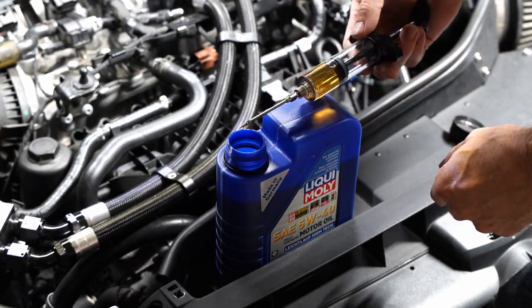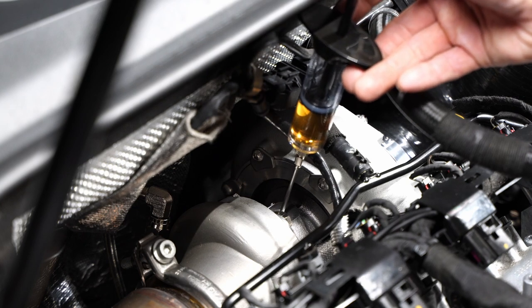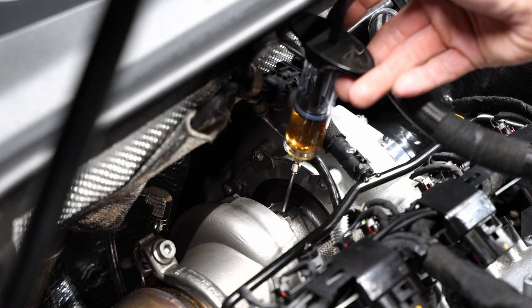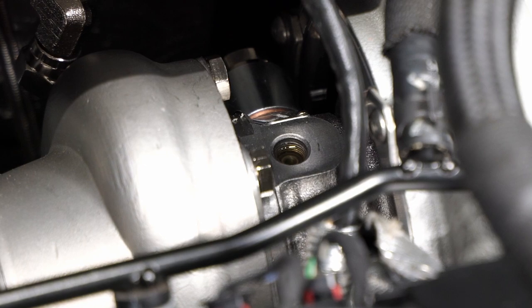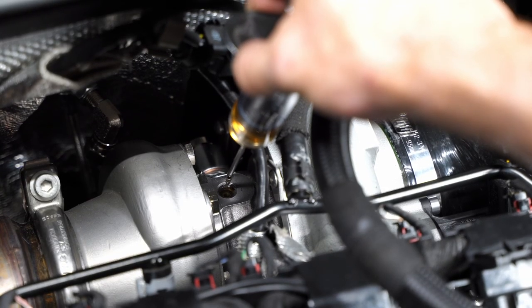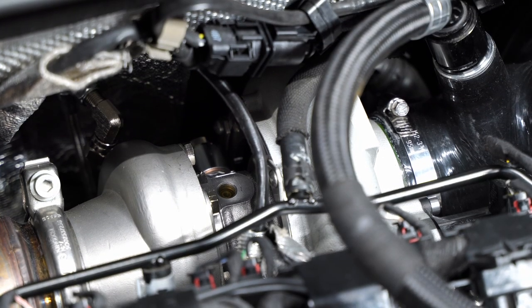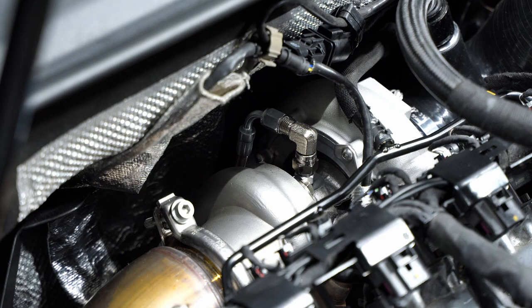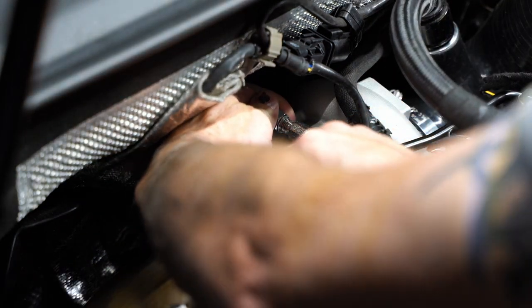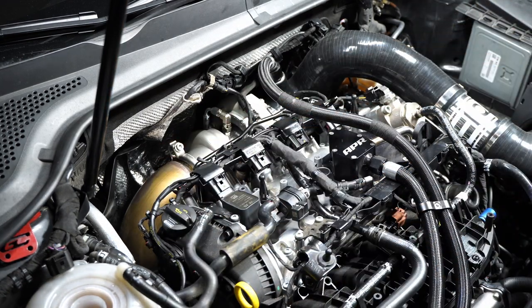The other thing I need to do is prime the turbo. I'm using oil and a turkey baster I keep in the garage - it works out great for priming the turbo. I'm filling the turbo up with oil, this is a ball bearing turbo, and letting that oil settle and seep through, then just keep topping it off until I feel like I've got a good amount. The best chance you have of a turbo with a long and happy life is starting it for the very first time with it already lubricated. If you fire it up without doing this, it's going to take a little time for oil to make its way through the oil feed pipe and into the turbo - by then you've already run it for a few seconds without any lubrication.